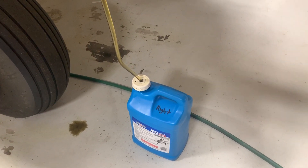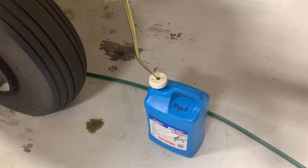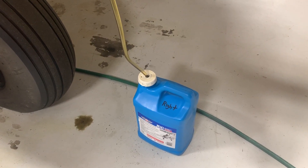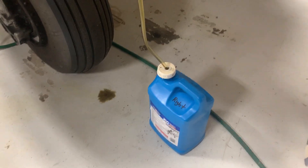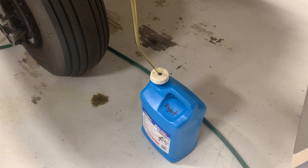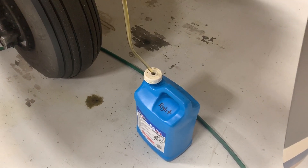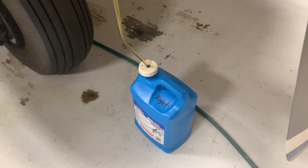You want to obviously mark these so you don't cross the oil between engines — make sure you're putting the same oil that's in this engine back into this engine. All the oil that drips into this bucket before we go fly, we just take the bucket and pour it back into the reservoir and reuse it. Instead of it leaking out all over the floor, we continue to reuse the oil because there's nothing wrong with it — it's just dripping because of the way the engine's designed.